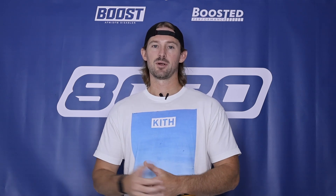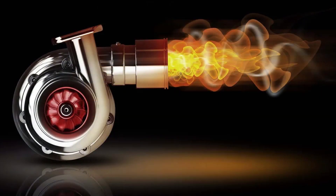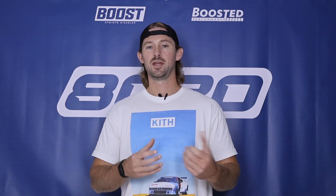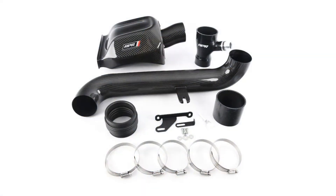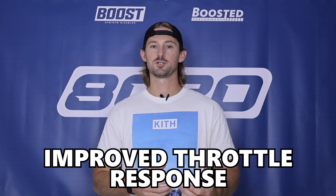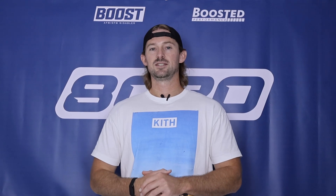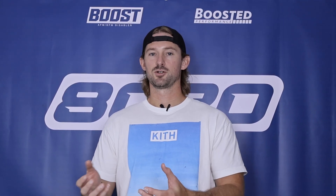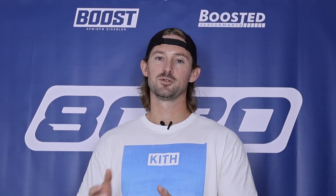Tuning is the one thing that has to be done — it's really going to help maximize the gains from all these other modifications, and it's where all the biggest gains come. You're getting your best price per horsepower out of it. My second recommended modification is going to be an upgraded intake system or a cold air intake. Once we start talking about producing higher boost levels from the turbocharger, it's helpful to bring more air into the turbocharger to help make it more efficient and take a little bit of stress off of it. An upgraded intake is going to supply the turbo with more air, which is going to allow it to spool a little more quickly. You'll see improved throttle response and get some decent power gains — somewhere in the 5 to 10 wheel horsepower range.